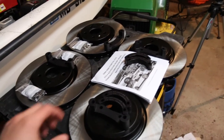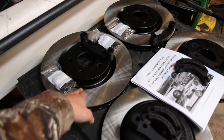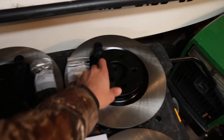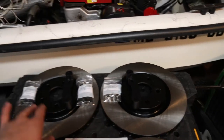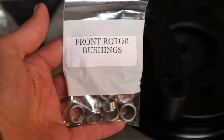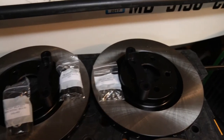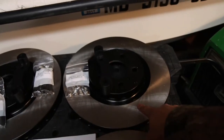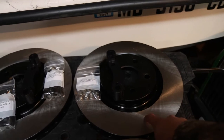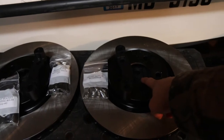I just figured I'd show you what I have so far. With the kit, it comes with all the brackets. So this would be the front, right here. Comes with two brackets and all of the hardware needed to install the kit — the bolts, these are rotor bushings, meaning that these go in here just to keep it centered. One thing to note when you are running this kit is that these rotors are from a 2010 Chevy SS or newer. You can use the ZL-1 rotors, it doesn't matter. The most important thing is that these are machined down.